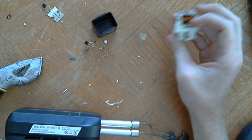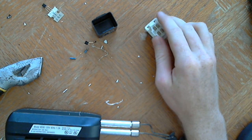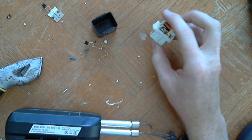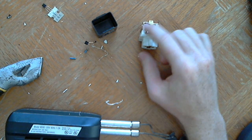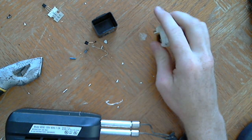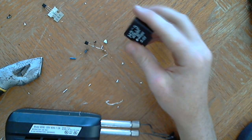And this is a relay. This is the inside of a relay. The basics of a relay is you'll have a small electrical current that would go through these 2 wires, that's these 2 pins, from a smaller gauge, thinner gauge wire, and it would make an electromagnet here, which pulls this little gate down, and it opens up a connection between these 2 fatter pins. The reason I'm using this relay is just because it's smashed.